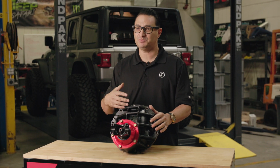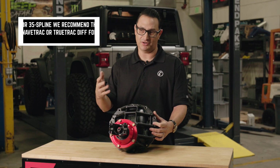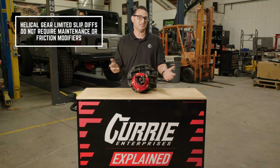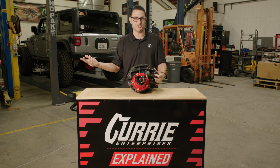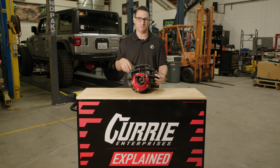Going to the 35 spline for something that's going to be driven on the street, something like the Truetrac or Wavetrac is also available in a 35 spline option. Both of those are what are called a helical gear limited slip. Some people call it or nicknamed it a worm gear style. Basically all that means is no clutch pack to ever have to rebuild, traction locks are gone the way of the past, and no friction modifier added to the gear oil. No posi additive, love that in a 35 spline option.